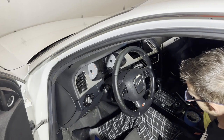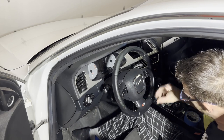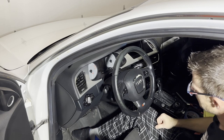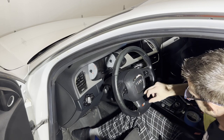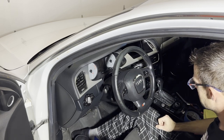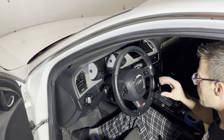You can do whatever you want. There are about 16 different tabs behind this that stick into it. You physically have to remove the airbag off of here, and then you have to disassemble the airbag completely to get to the bottom of this where the 16 tabs are at. You will have to destroy those 16 tabs to get this piece to come off. It's a dangerous process, and I think the easier way to go about this will be just to paint this